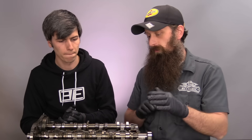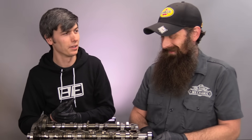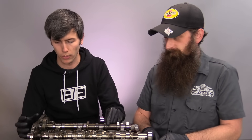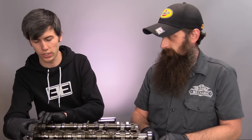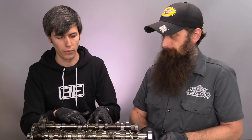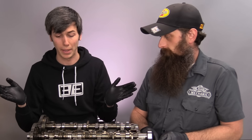That's all ECM controlled — the engine computer does that based on the scenario the vehicle is in. It knows better than most of us what it wants from the engine. Moving along to the intake side, as you can see, there's just a single cam profile. What we have here is variable valve timing. If I hold this stationary you can see the chain won't move — we can advance it or retard the timing. On the intake there is only one cam profile, so all we're doing is shifting when it opens and closes. The cam profile itself remains exactly the same.